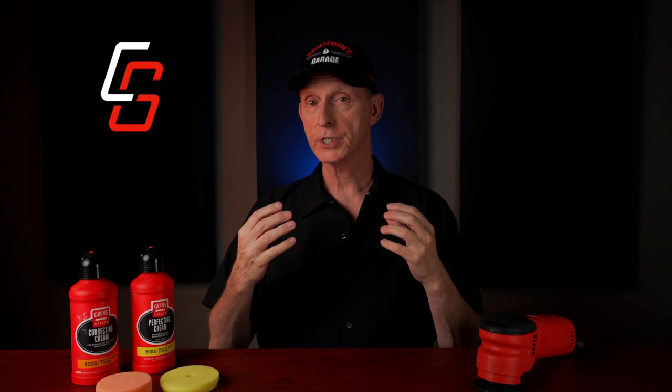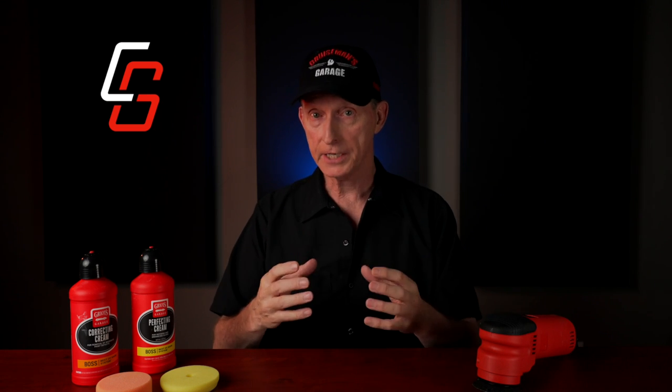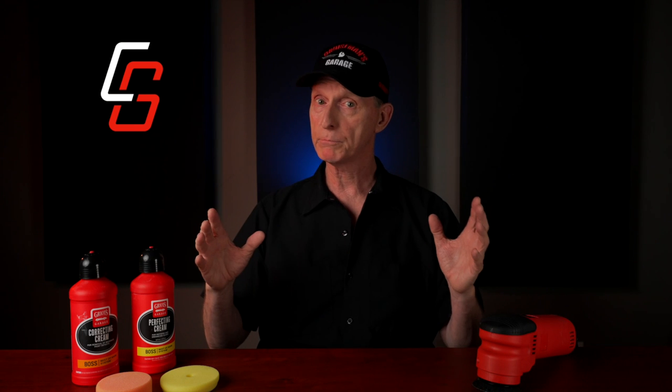Now today, we're going to be talking about two basic forms of abrasive liquids. The first one is referred to as a compound, which is the most abrasive formula and can be used to smooth out scratches, swirl marks, oxidation, chemical overspray, etc. These compounds actually cut into the clear coat to make it flatter and smoother, and there's many different brands of